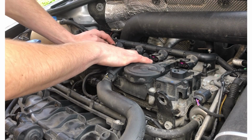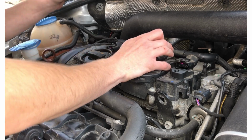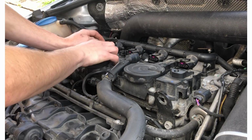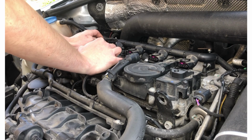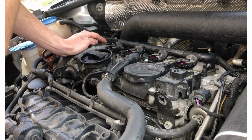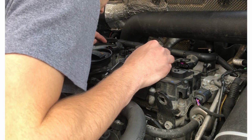For now, I'm just going to go ahead and I'm really hoping that cylinder 3 has problems, because the coil out of 3 really does not look like it's in that bad of shape. There's a little bit of oil on it, and there's some oil buildup inside of the well here. I'm going to go ahead and sop up some of this oil, and I honestly should have done that in hole number 1 before I removed the spark plug, because now I run a risk, because there's an opening straight to the cylinder and to the combustion chamber. I run the risk of contaminating it. So honestly, what I might do is put the new spark plug down in there and then clean it up. And yeah, hopefully that will solve some of my issues.